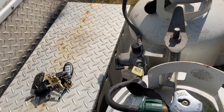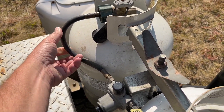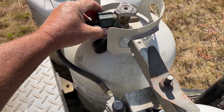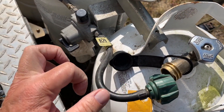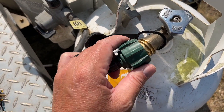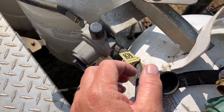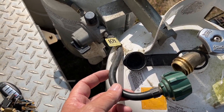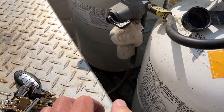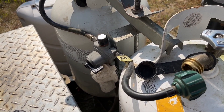As for the gas valve itself, it's original to the trailer. These lines are hard as a rock — they're not even flexible anymore. They've done their time. I have no problem spending a few dollars replacing these. I can see that the knobs don't match, so one of these lines was already replaced at some point. I'll guess it was this one because it's got a label on it, but it was probably replaced a long time ago because both are stiff and old. It's not a hard job — the gas valve just disconnects from the bottom, reconnect the new one, and bob's your uncle.